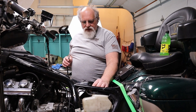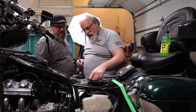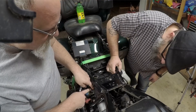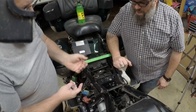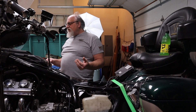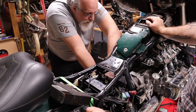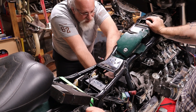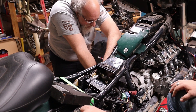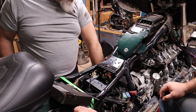This ground cable will go from the negative side of the battery to the engine block, to that U-shaped bracket that goes around the box — the same thing that the fuse bolts to, with the ears on it. That metal bracket goes down through and holds the whole battery box up so it's not just on the plastic. I looked at pictures to get an idea of where everything went, and that's where it needed to go. The cable I got is 18 inches, which should be enough.